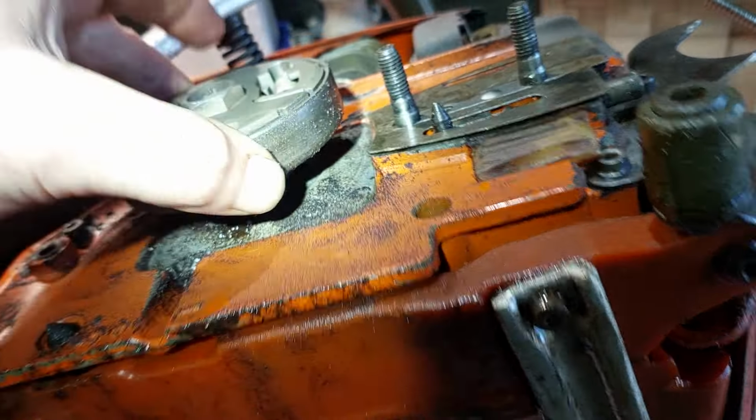So you've probably seen this before, we'll do it, see, on the camera. So, 19mm. It's a left hand thread, so you go clockwise to undo it. Hopefully it comes off easy. When it starts coming down, go easy, just enough to undo it and wind the last part off, otherwise the clutch can go everywhere. With shoes. It's alright.